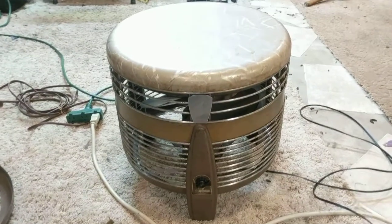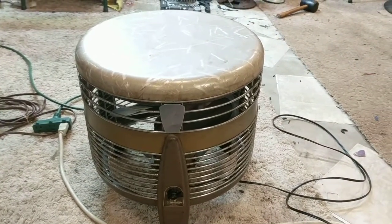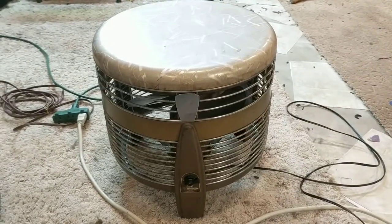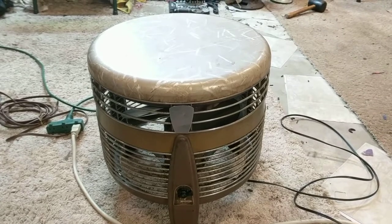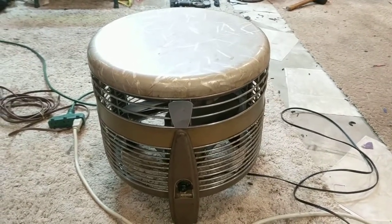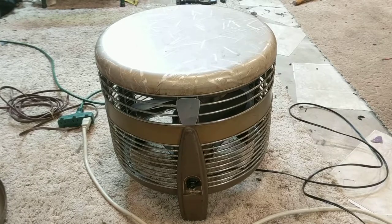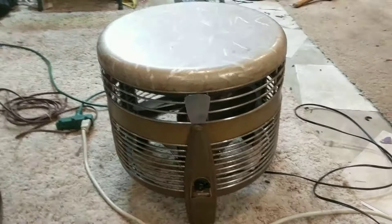I have the same exact fan apart right now — I'm taking it apart. This one I already took apart, so I have some more experience with these. I did have one from 1956 where the speed coil wire broke when I was taking it apart, which stinks. Now it needs to be rewound to be usable. I like this one better because the speed coil is out of the way and I don't mess with the wires much. It's really annoying that Emerson Electric used a single wire instead of soldering multiple wires together, because if it's just one wire and it breaks, there's no connection.